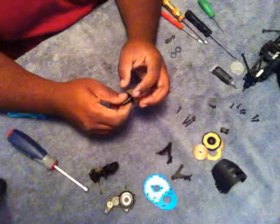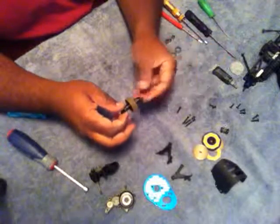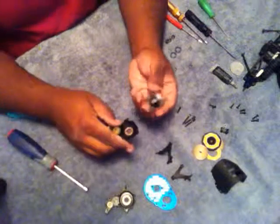You will go through a process with those videos I'm going to put in the description that will show you how to break this in, and it's going to show you how to set the diff. Now, you do set the diff with the car assembled, just so you know. So go ahead, rebuild your diff, and we're going to go ahead and put the transmission back together.